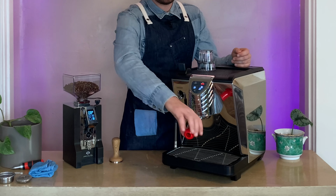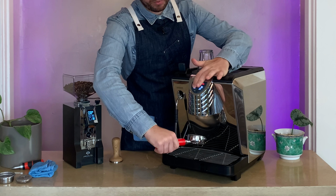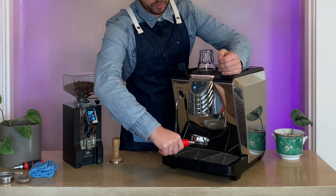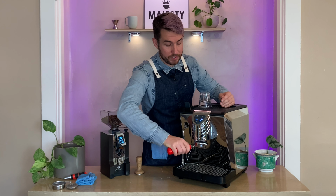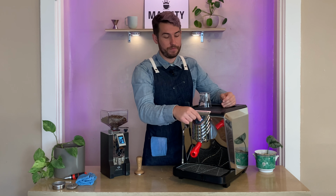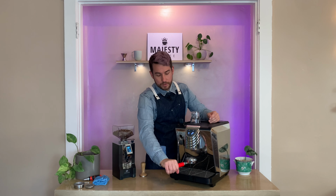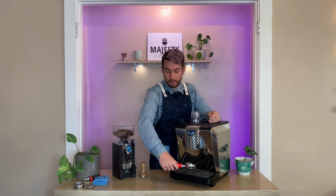And at this point, we're going to discard the water with the espresso cleaner. Rinse our portafilters to get off the cleaner entirely. You can just rinse with warm water. Replace our portafilter with the blind basket and run for another 3 cycles, 10 seconds on, 10 seconds off. This time just with the clean water. All right, discard of that water. It should run very clean at this point, and there should be no espresso cleaner left in there.